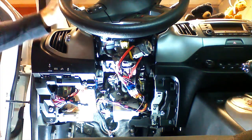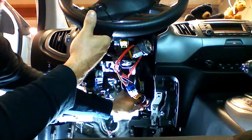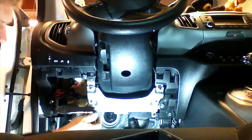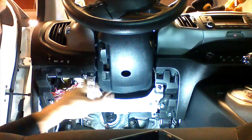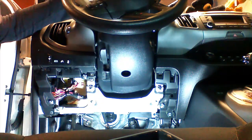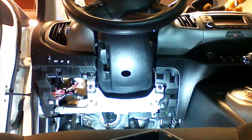Before you reassemble the car, do a range of motion test. Unlock the steering and pull all the way out on the steering column. Make sure we have nothing binding, nothing too tight that won't let the wheel move throughout its full range of motion. Everything is going together beautifully with our wire routing. We're ready to insert our diagnostic plug and put the last piece of the dash on after we tighten these bolts. Whenever you're reassembling, look for any interference problems — make sure when you snap the plastic on we don't have any binding. Make sure the plugs are positioned correctly so the steering column cover plastic doesn't bind.